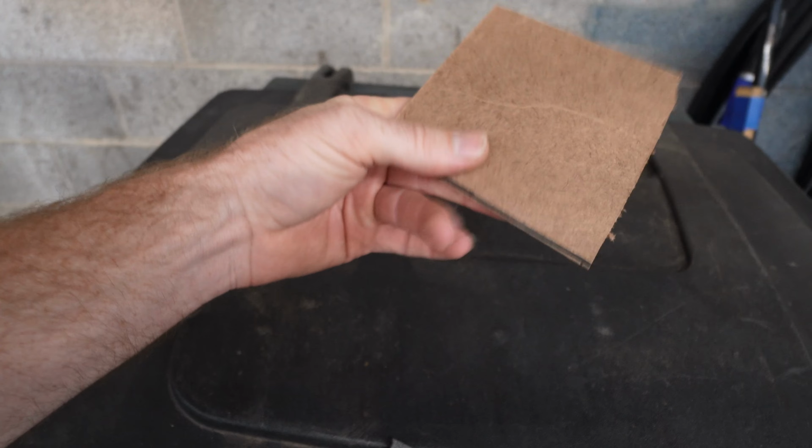Russell, what are we doing? I'm trying to figure out how to do this exhaust because it's all hanging below the frame and it's crooked and it's shooting towards the ground, and I don't want to load it up too much on the headers, so I feel like I'm just going to have to start over. Well, not start over, just do my own version. That's basically what we're doing to the whole truck almost. I just want it to be right. I mean, as right as I can make it anyway. So we gotta go to the exhaust place? I think so. I'm gonna have to do some layout and then we'll figure it out.